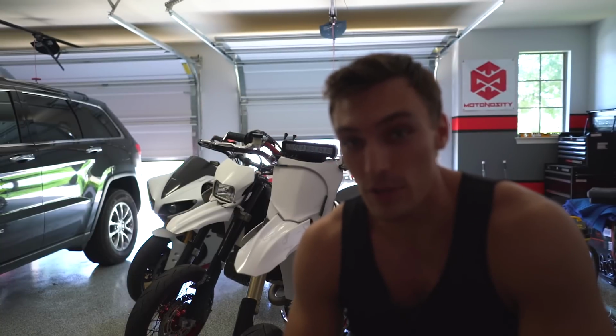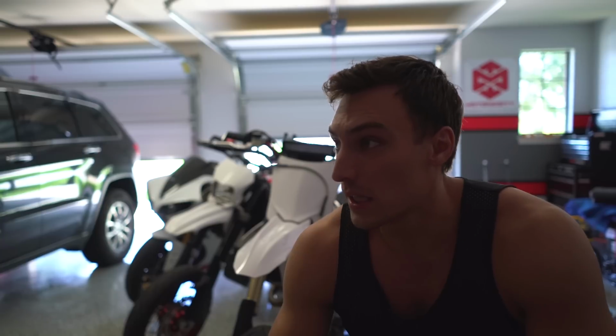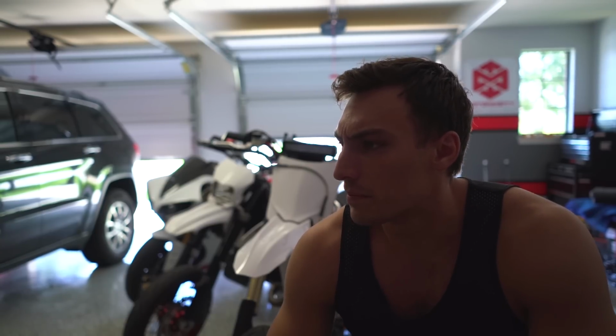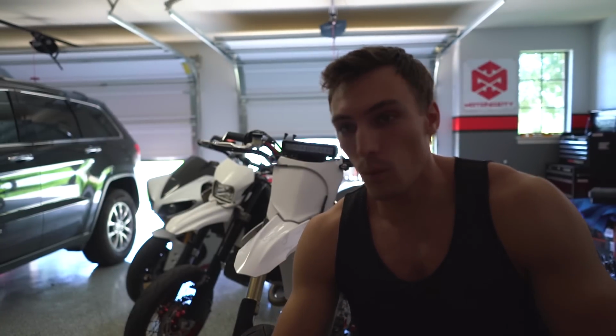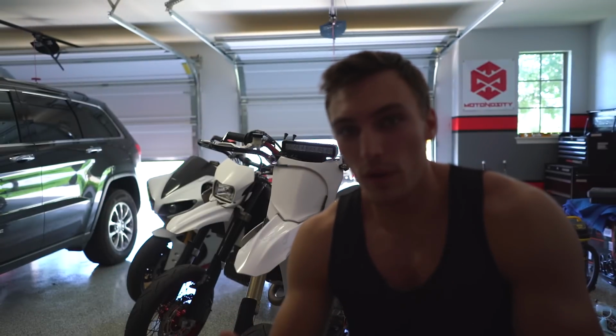So again, if you want to make your dirt bike street legal, usually those 4 things are primary things you need: horn, headlight, tail light, mirror. I have no idea why I just said it like that. And there are kits that you can buy which basically just give you everything that you need: the wiring, the battery, the whole setup for that, including turn signals if your state or country requires that.